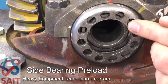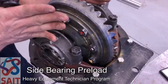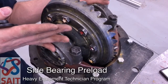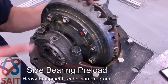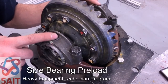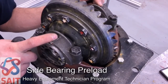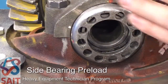Then what we're going to do is turn two additional notches on the adjusting ring. That's going to deflect the case — actually spread the case apart — and that spreading is going to put the bearings under tension, which is the bearing preload. Your service manual explains this as measuring across the caps with measuring rods and an outside micrometer to measure the case deflection, but two adjusting notches will also get us the same deflection we're looking for.